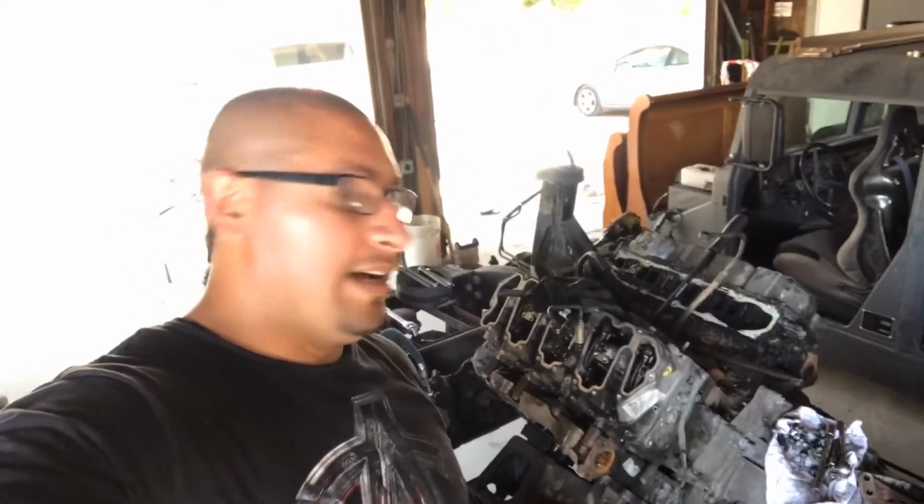and then we'll come back. All right, so I literally have been at this for at least 3 hours. I cannot get these injectors out. I guess they really must be seized in there. The only thing I can think of is the O-ring just melted, because I don't think there's anything else really contacting. I think the O-ring just seals, and goes between the head and the injector.